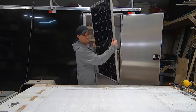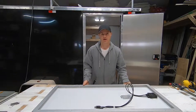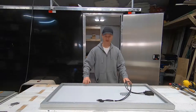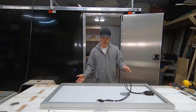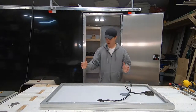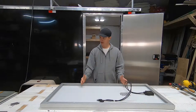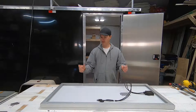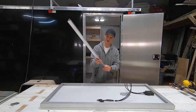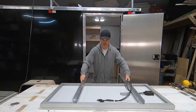I have one solar panel that I'm going to mount up top. I rigged this up so that I can do two solar panels, and I want to make it so I can tip them up. You put the same ones at the back of the trailer. The top is 16-inch center, so I'm going to do 32-inch. I've got to put four L brackets on and two bars — these two aluminum bars I cut — I'm going to mount one here and here.